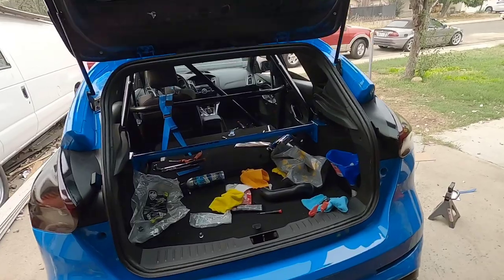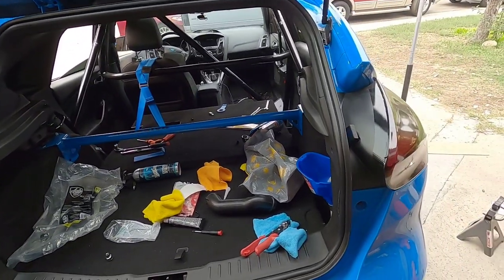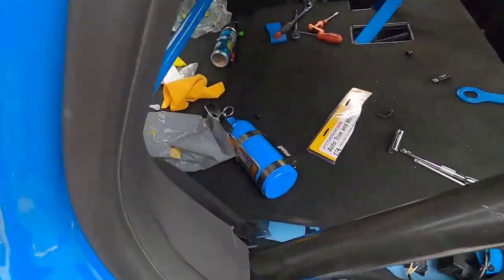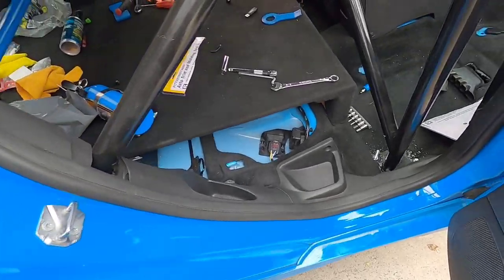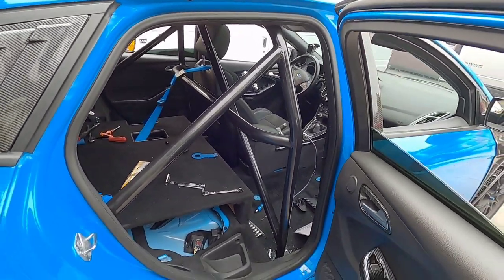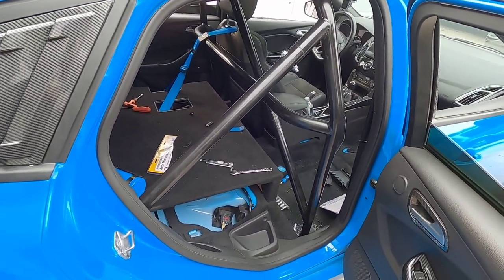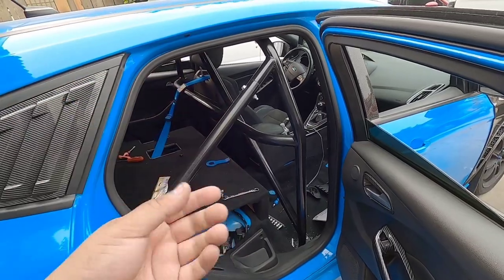Apologies — didn't record most of it. It's honestly a tough install, especially your first time. From where we left off: we drilled the holes, put in the hardware and the bracket that came with it. Down on the bottom, there's a cover — when you remove it, there's a little stud that sticks out. You can either keep or remove the stud. I kept it to keep the splash guard under it, so I cut another hole in the mounting bracket so that stud could come out while still clamping the splash guard on the bottom.